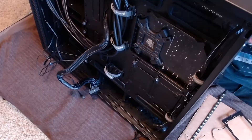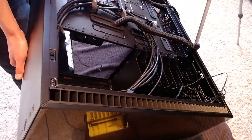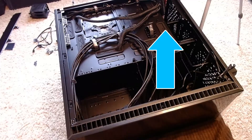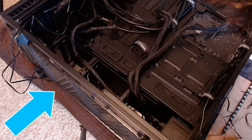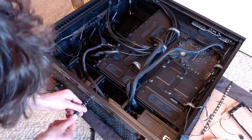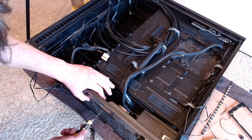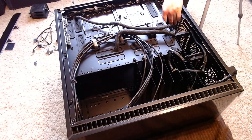There's the first motherboard cable, the second motherboard power cable, and a SATA power cable. With the cables fed through, I begin connecting them to the power supply, as once it's installed it will be harder to access. Thinking ahead and planning your build can save a lot of time. I have to remove the bottom fan filter before loosening the hard drive cages. Luckily, this process is quick because the cages are attached to sliding rails — I'll move them out of the way and retighten them into position. Four screws per cage. The added room allows the power supply to be slid into place and installed. The screws are reattached to the mounting plate and one more secure check of the cables is performed.